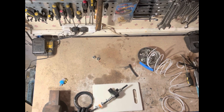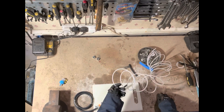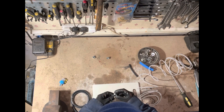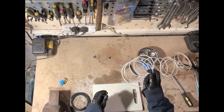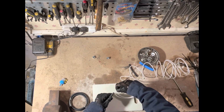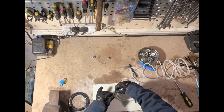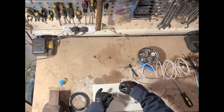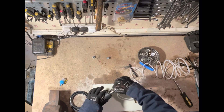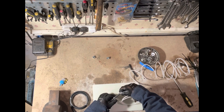The assembly so far: I'm going to have a short run of this additional fuel hose to my fuel dip, then the upgraded fuel filter, a short run of hose, the fuel pump, another short run of hose, and then the nylon fuel line which goes into the end here — you need to push that all the way in. This rigid nylon hose inserts into the flexible hose; make sure you push it all the way down so it meets the end of the fuel pump barb, then clamp it.